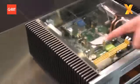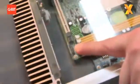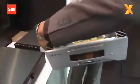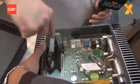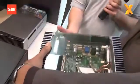And you're running it, is that an SSD on the side there, or is that just a little 2.5 laptop drive? It's a standard 2.5 HDD in there. So they produce a lot more heat than an SSD, so you've got that just stuck straight in the side. Exactly, so that even this way the heat is dissipated. In this case, the power supply is equally external, so that it comes with a flex power supply over here. Right. I was going to ask. There is no power supply in there because I saw the connector here. You see. Exactly. So you've got the actual power brick doing the step down on the voltage outside. On the outside, just like something like an Xbox 360. Exactly. That way you are 100% sure that it's absolutely silent and quiet.